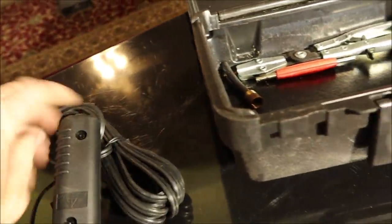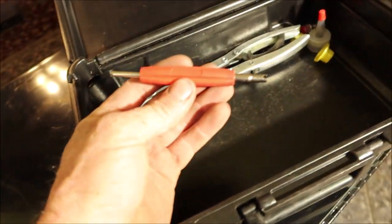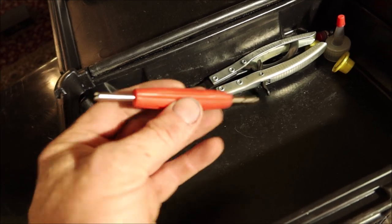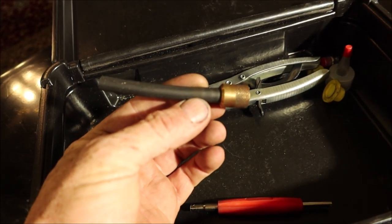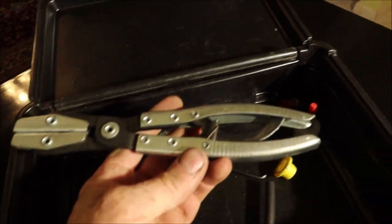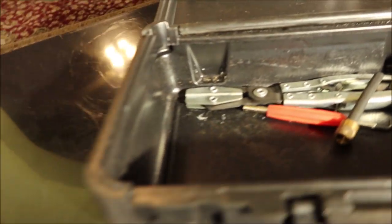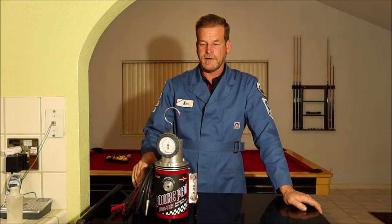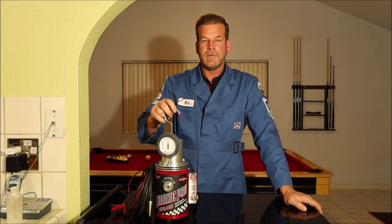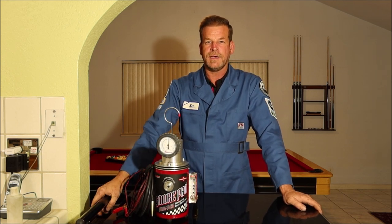Here's the oil that goes in it to make the smoke. It also came with this flashlight that hooks up to the vehicle battery. And these are for taking those valve stems out of the EVAP system — they're much bigger than a tire valve. That's the actual piece that screws on, and the smoke machine hooks up to it. I also put these pliers in here because I like to sometimes pinch off different hoses. If you're working on modern cars, this smoke machine is a must-have tool. Redline Detection makes the best one since they only make smoke machines and have more accessories than anyone else.